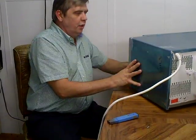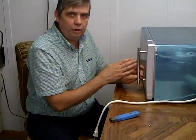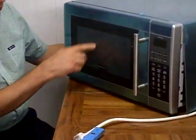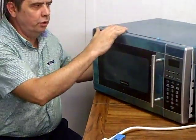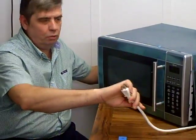There are safety interlocks so the machine will not work unless the door is shut. Also, if you look on microwaves, there are perforated holes and a fine metal screen designed to stop the microwaves from coming out. So it's very important that once you remove the back of the microwave, don't plug it in, don't play with it, don't try it anymore.